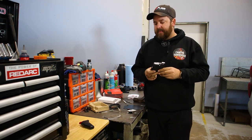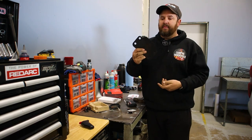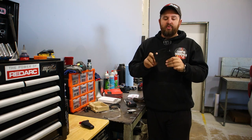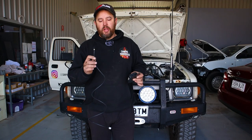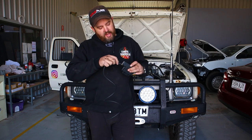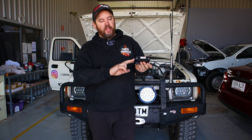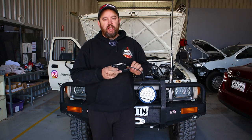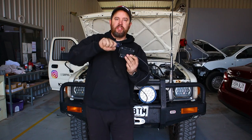That's all I can find in this car, so I'm going to have to do it up incredibly tight so it doesn't move. If you don't have to use the 25mm flat, you can just use a piece of flat steel, drill the holes you need, and mount the unit straight to that. Now we're going to plug this cable in before we mount it — it makes it a lot easier. Clip it straight in as we're putting it in, and plug the other cable in the other end too, then mount it. Otherwise it can be quite difficult to put your hands up and plug these in later.